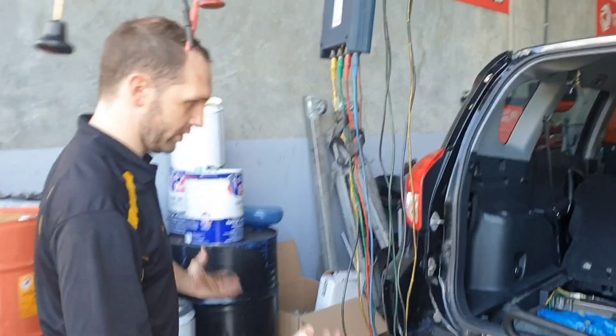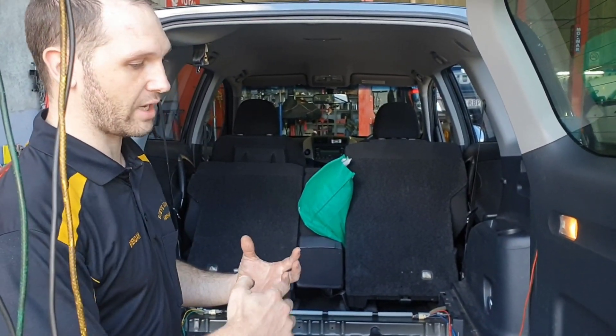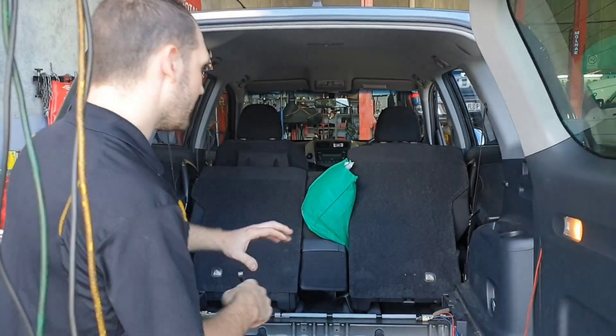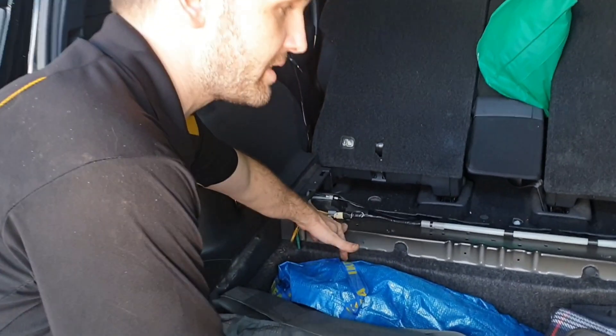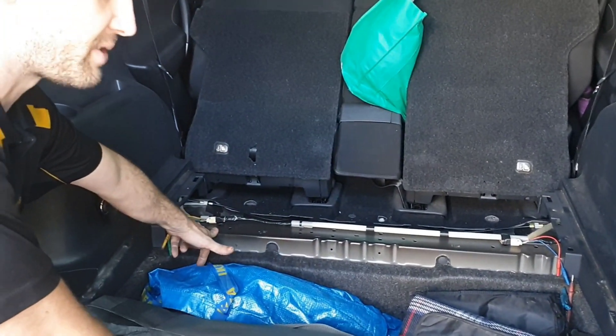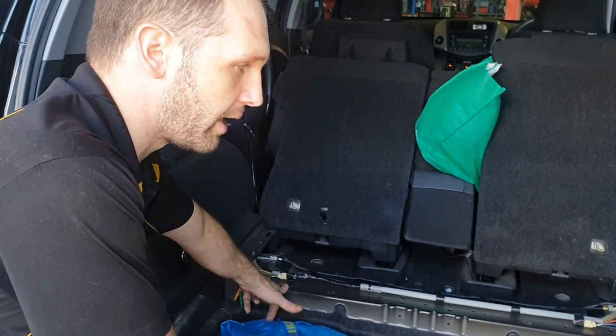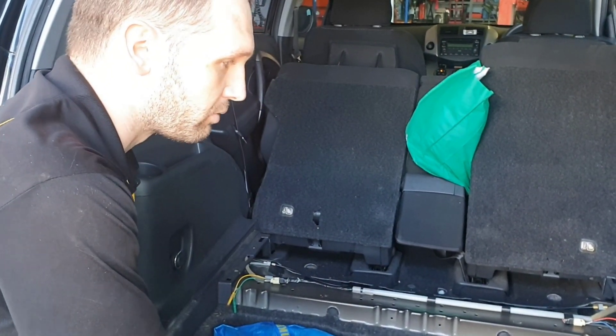If we look in the back here, the sensors go into the hub and they read off the bearing, and there's no connector until you get inside the car. When we pull the back apart, these are our two connectors — left-hand rear and right-hand rear wheel speed sensor. This is the one we suspect is at fault, but I'll show you how to test it and compare it to a known good one for confirmation.